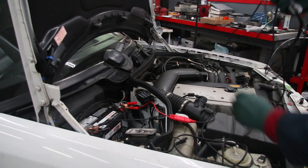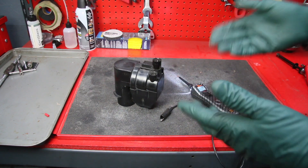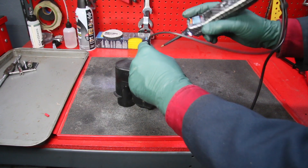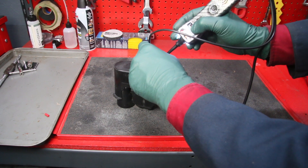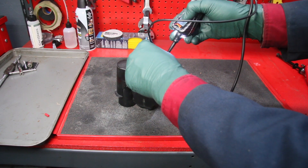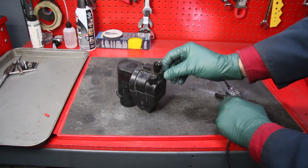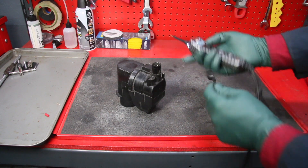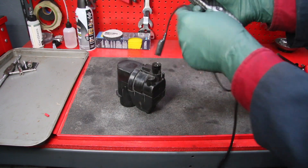With this cable I'm going to the workbench to show how I test an electrical motor. I have a W126 and I'm trying to figure out what's wrong with the power door locks. The first thing you want to do is test the motor. I touch the two contacts, push forward on the rocker switch, and you can hear the motor running. I reverse direction by swapping the leads, push forward, and the motor runs the other direction. I can also hook up a vacuum gauge to see if it's properly sucking and blowing.